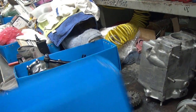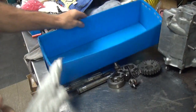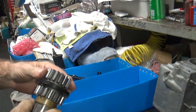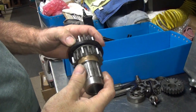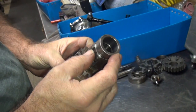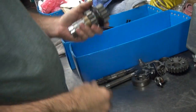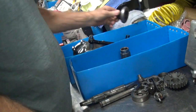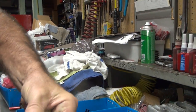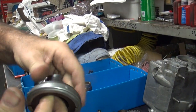That's my bad box. The good box is over here — relatively speaking. It still has rust issues but at least the bearing area looks good; it's not all pitted on the inside. Not perfect but it's usable. This here has a big chunk missing out of it — it feels pretty rough. So that'll be a little bit of clutch chatter. That should be over in the bad pile.